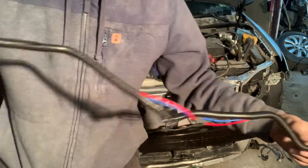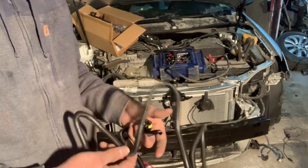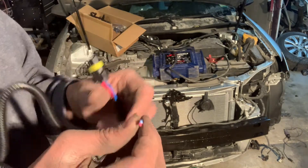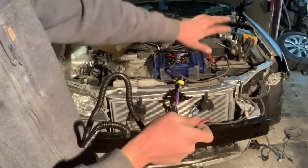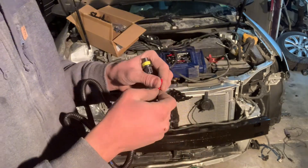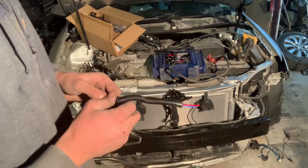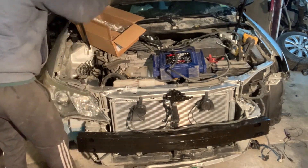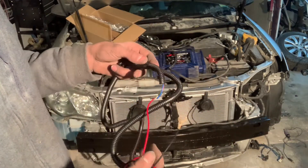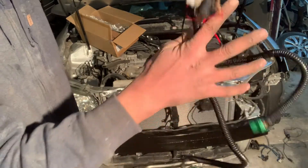Now I cut these two wires — basically positive and negative for the connector — one for the left side and one for the right side. All you need to do is just wire these two onto there and it's going to basically run with the car. So if the fuse blows in the fuse box right there, this would stop working, but it's not going to overload the headlight or the bulb or anything like that. The reason I didn't use the harness they gave with the kit is because it's just too much work when you can do it a simpler way with just two wires.